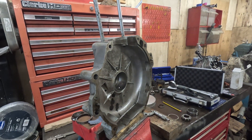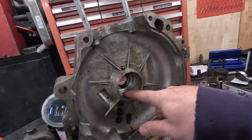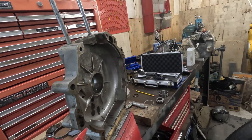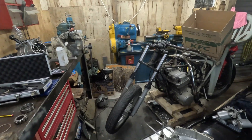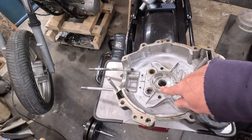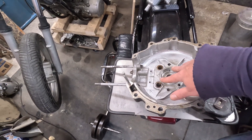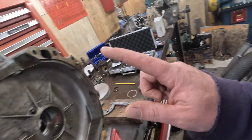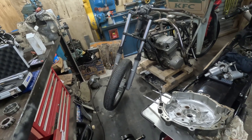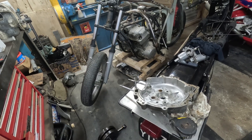We need to figure out what we're doing with these crankcases. I've been ringing people and trawling the internet trying to see what bearing sizes I can get that are useful, and there's not many. I still haven't decided whether to machine that one at all. The bearing is a little bit looser than it maybe should be, but I don't think that one had actually spun in the case - I think that one had just spun on the crank, whereas this side had done both. What I don't want to do is not do that one and then it starts.